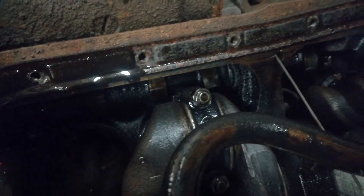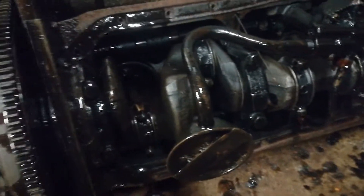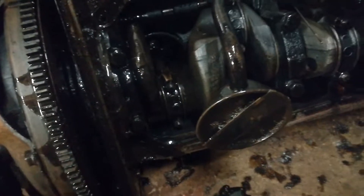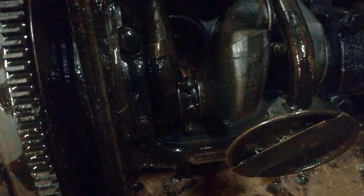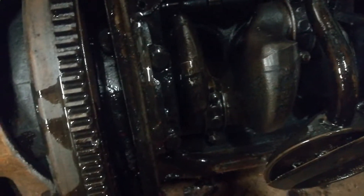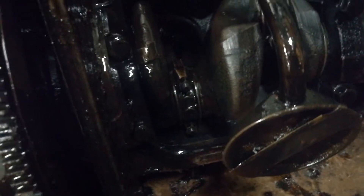Pretty cool little engine all in all. The cylinder heads are wild — look at the depth, you have a valve up there. This is known as a full-pressure oiler, so it has an oil pump. The older ones had splash oiling like a lawn mower — basically just a little lip on the connecting rod splashing oil into the bearing. The bearings weren't fitted, they were molded into the connecting rods — babbit bearings.